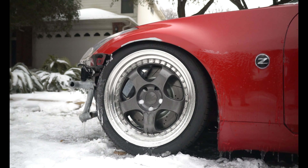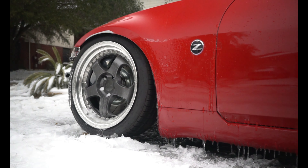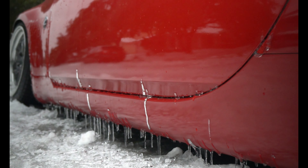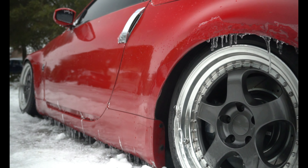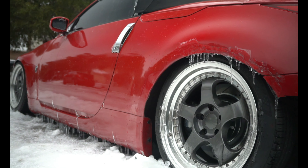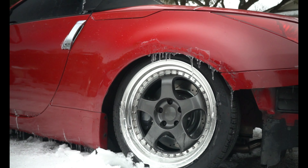Some issues I ran into at first were mainly just doing all the research — going onto the AutoZone website and comparing a bunch of different rotors from cars that use Brembo-style brakes, like the Mercedes ML, S-Class, Acura TL, and Toyota Tundras. I finally found a car in the junk yard thread that used brake rotors with a similar offset and diameter, which was the Lexus LS460.